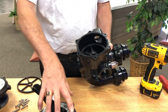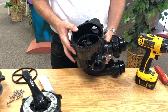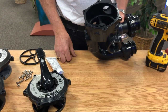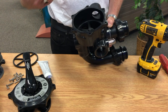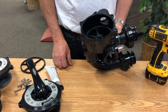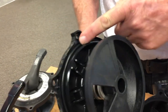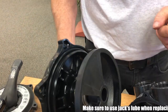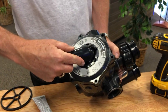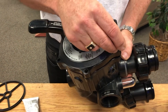Now we take our key assembly. Just like a 714 valve it can be rebuilt, but it's actually easier and not much more expensive to just replace the whole thing — it comes pre-assembled, you just put it in and line it up. There is an O-ring under the key assembly; if it's damaged or worn it can also be replaced. Once that's in, drop the key assembly down, line up the notch, and make sure filter is pointing to the tank.